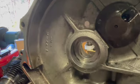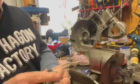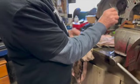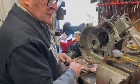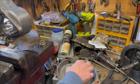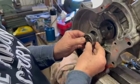So we can see that, yep. Yeah, and this is what it's supposed to have on that side, an encapsulated roller bearing that you can't pull apart. That's supposed to be in there. Righto. We had one of those on that side, that way, which is correct. And the other one was in there back to front. Backwards, like that. Yeah, right.